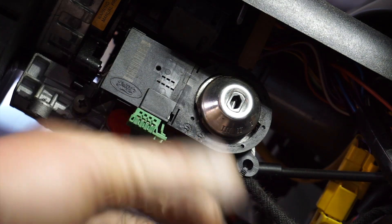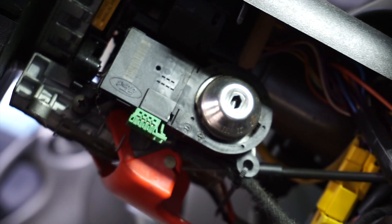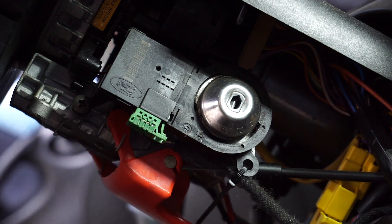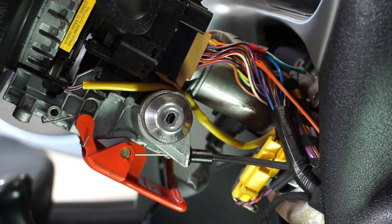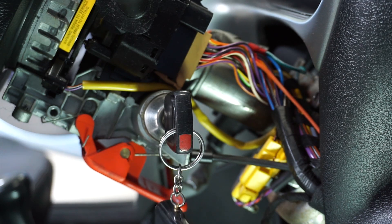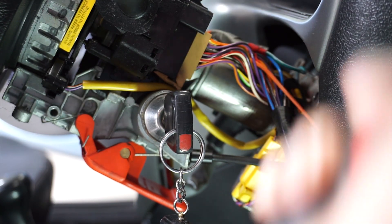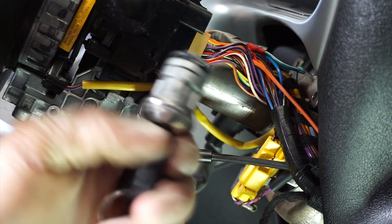Here is the little receiver thing and we've got to replace that one with this one. There's only a screw holding it in and a little cable tie. Then we've got to get the barrel out. This will be useful if you ever have to remove the ignition barrel — you need the key. If you haven't got the key that could be a problem. You put the key to position two, then on the top there is a pin and you need to push the pin down.